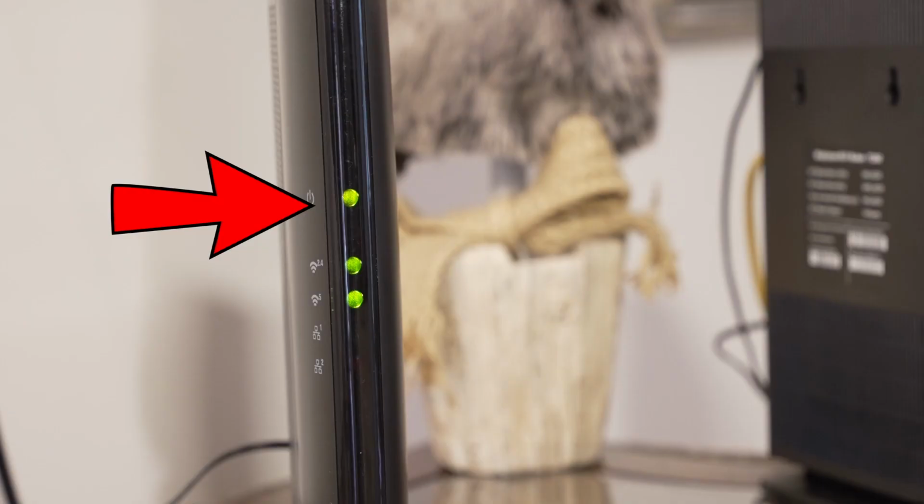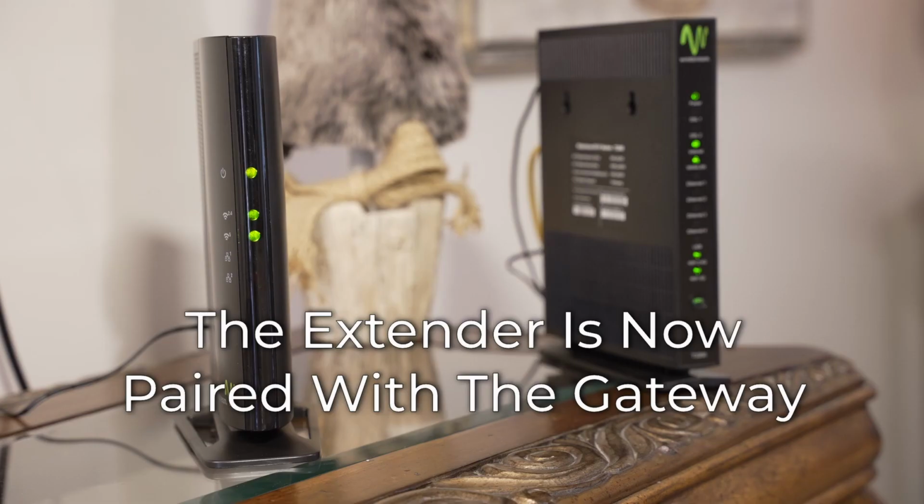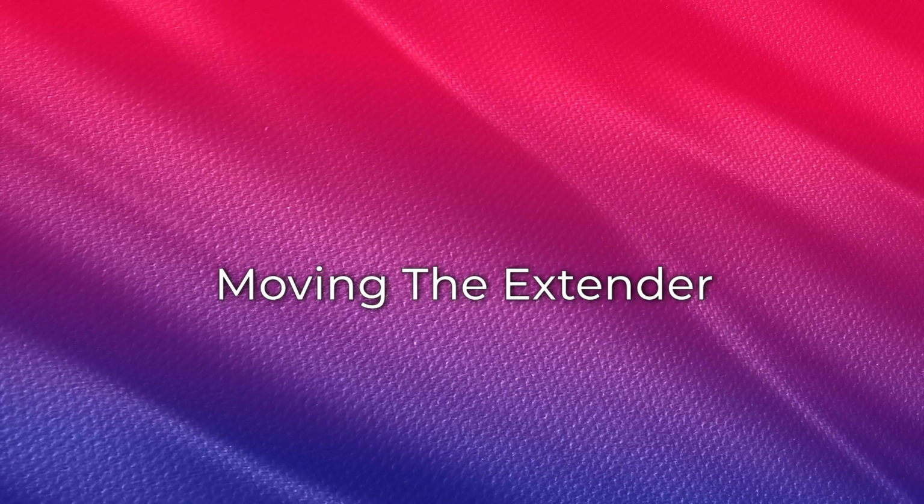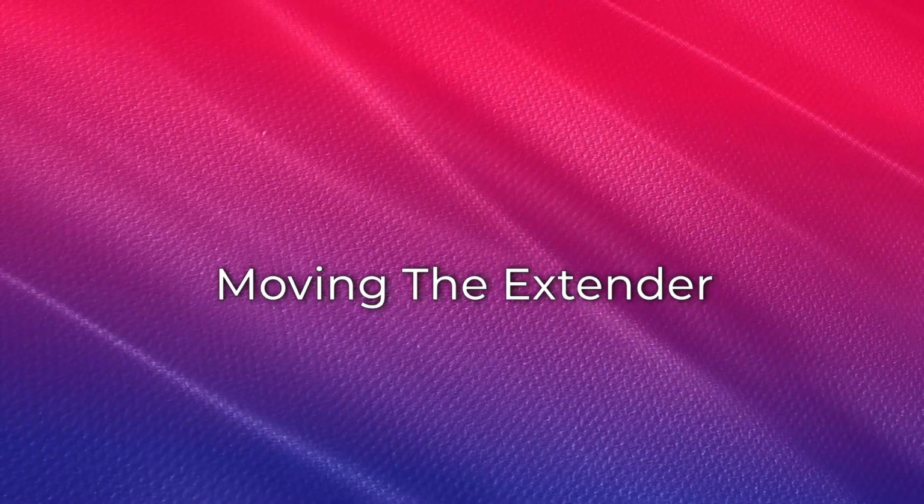Wait until the power light on the extender is green. This can take up to 3 minutes. Your extender is now paired with your gateway. You can now move your extender to its intended location. Follow these steps to move the extender.